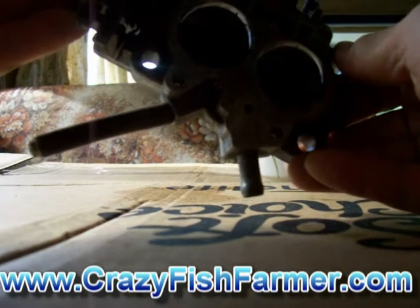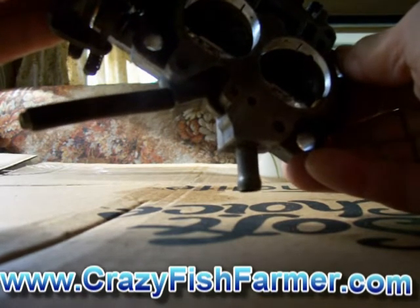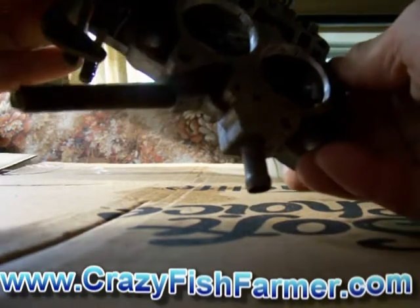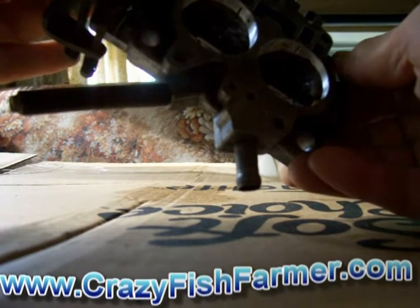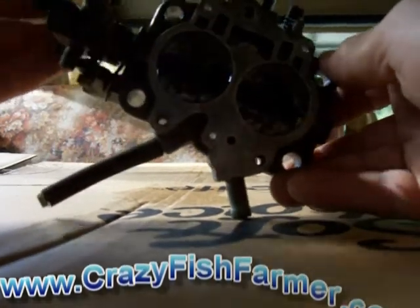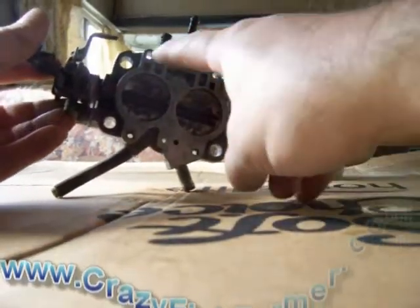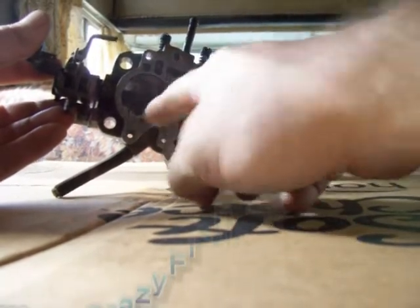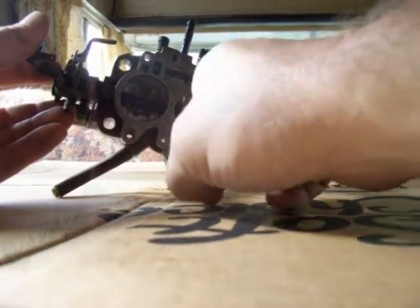When the motor slows down, the governor opens up to allow more gas or vapor in, and when it speeds up, it slowly shuts back again. Same concept here — we just step on the gas pedal to let more air and vapor in to increase horsepower and go faster. So this throttle body is what's important to me. I'm going to build some kind of bracket that fits this, hollowed out in the center, then grind it down, make it fit, and put some kind of tube on top.